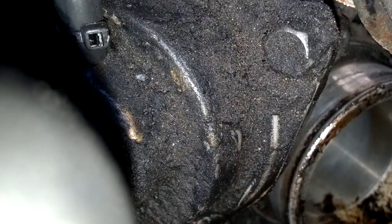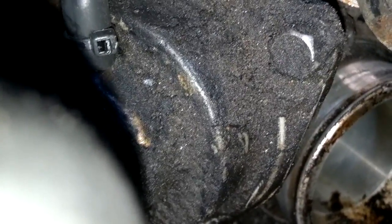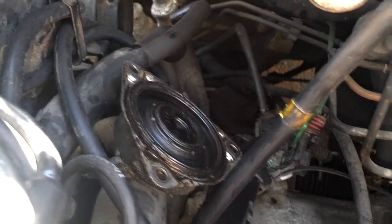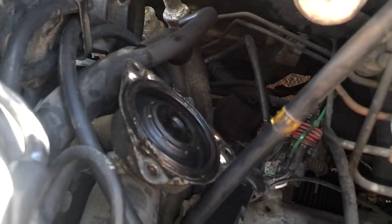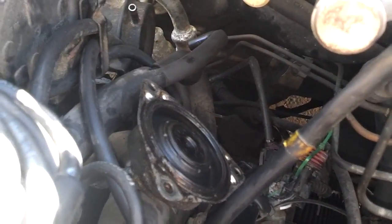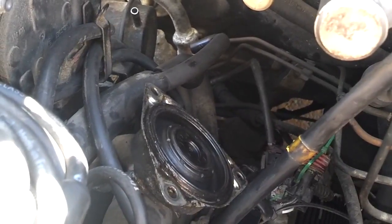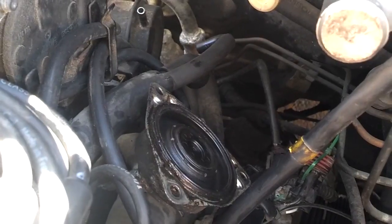Work your 10mm sockets or box-end wrenches down there and take the three bolts out of that valve. I got the housing loose — all three bolts out. All I can say is wish me the best in getting that lower bolt started back in. I'm going to go ahead and pull that diaphragm out and see what kind of condition it's in. It looks like I have a small hole in it from the quick glance I did.